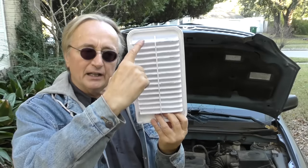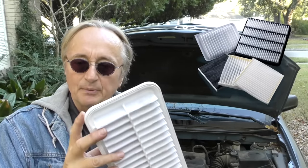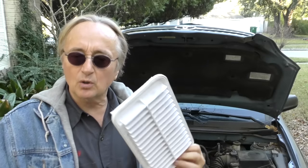And when it comes to replacing your filter, my advice, you best stick to the original equipment ones that came with the car. The cheap aftermarket ones, often, if you count the number of pleats, have less of them. They don't filter as well. The material can be cheaper made. They're not all that expensive, even the original equipment one. You're much better doing that than buying the cheapest one you can that isn't going to work as good. When you consider the hundreds of thousands of cubic feet of air you're going to be burning and the thousands of gallons of gasoline you're going to be burning, you'd actually save money buying a more expensive filter if it works better than a cheap one that doesn't filter as well. And you get less power, worse gas mileage. In the long run, buy a quality filter. Don't save pennies and lose dollars.